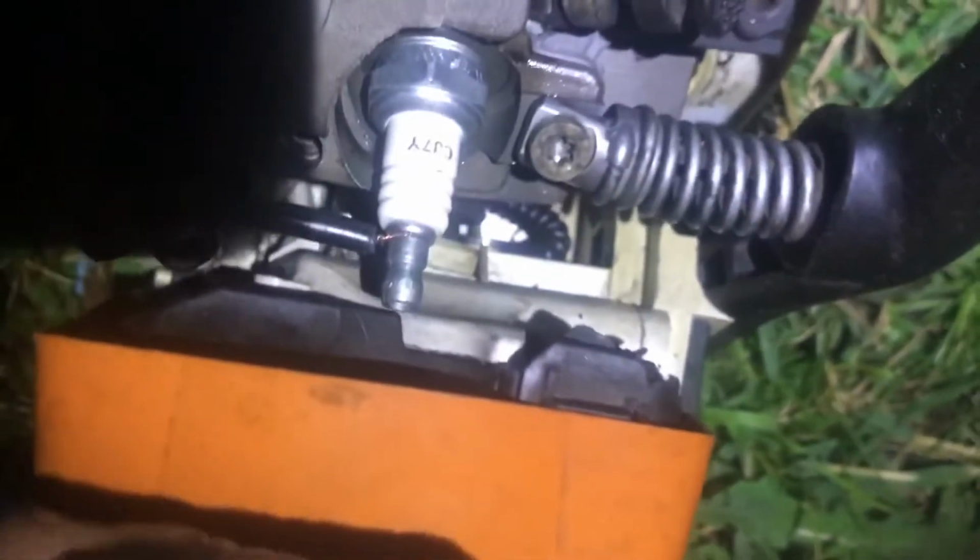So it might have had several problems. Number one, all the bolts had backed down. Number two, I think this was a recurrent problem. Number three, don't use the rebuild fuel line in any of the saws. I thought this one would work good, but this was the Chinese fuel line. Don't use it. I went to the Stihl place and got the 361 fuel line for $5. So go with the original.